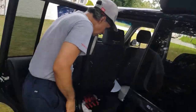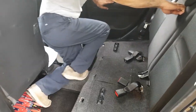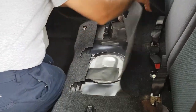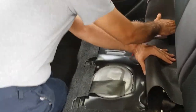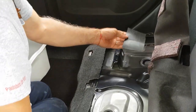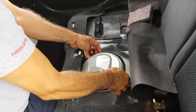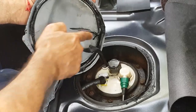As you can see over here, I pretty much cleaned it out and it's out of the way. Lift this up — there's our fuel pump access. We managed to prop this up so that way it won't click back on you. Take off this cover that protects the wiring harness and put that aside. I already took this off before — it's held on by some special tacky cement. Just pry it off nice and easy with a flat blade. As you can see, there's that blanket insulator right there — put that to the side.